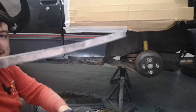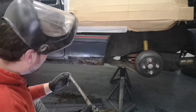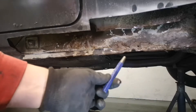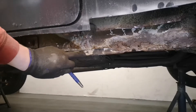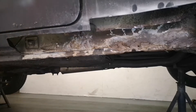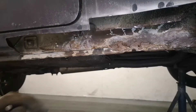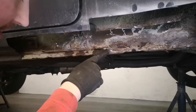Just wanted to stress a point - hopefully you can see this. The metal on the back is in really good condition, so once I've ground this back down I should be able to find some suitable metal to weld to. I'm now going to use a centre punch to find the centres of the spot welds and then drill them out using a spot weld drill. It can be a little bit difficult to find a spot weld, so I always recommend using a wire wheel on a grinder to clean off all the original underseal first - it makes it a lot easier to see them, and they're generally slightly indented in.